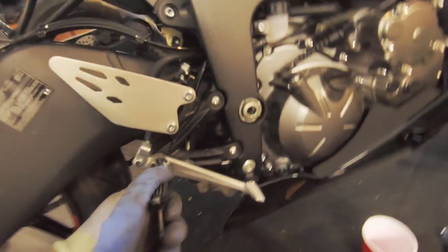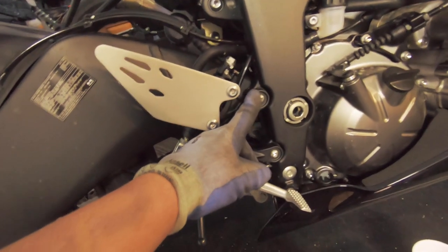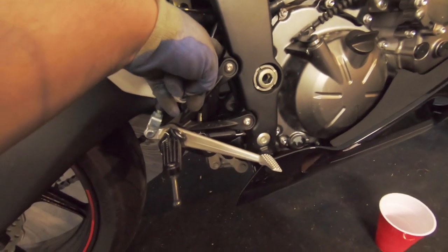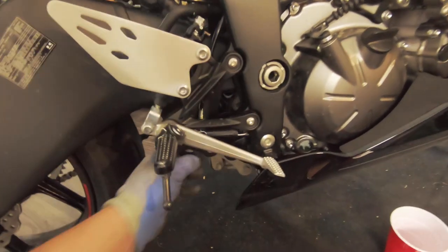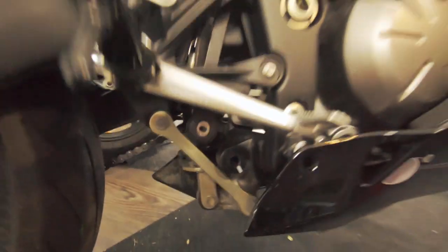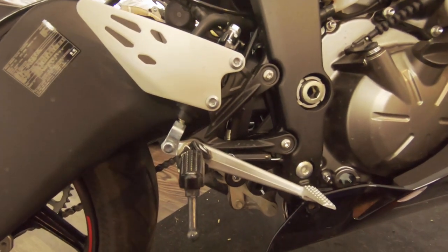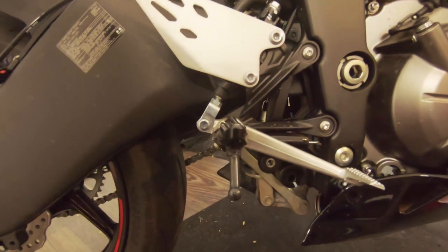All right guys, we got the rear set back on. Everything's nice and tight. I looked up torque specs and checked the forums — I saw anywhere from 17 to 25, so I just did 20 pounds. Mostly they were saying 18 pounds, so I did 20 just to be a little safe. They were recommending not using red Loctite on it. However, since I'm adding a bracket in the back, I torqued it down to the frame with no Loctite, but the nut to hold the hanging bracket I went ahead and put Loctite on that part of the bolt and on the nuts so that vibration doesn't back them out, since they don't have a lock washer. Now we've got to take the M4 exhaust and put it in, but first I'm going to remove the baffle because I don't care to have it on there.